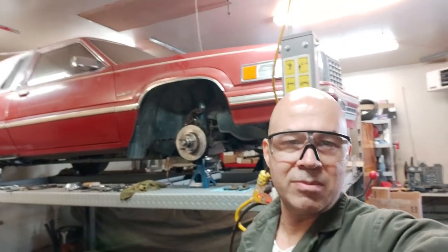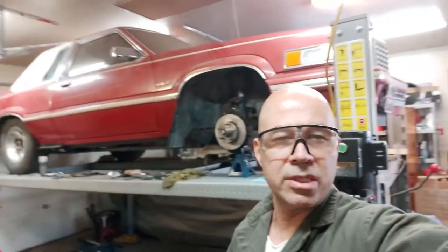That's okay, but the problem is you're limited with the rims you can use. So I decided — well, first I made the mistake — I bought the Mustang 2 kit from Speedway Motors: a nine and a quarter rotor. The spindles are the same, but the geometry of the rotor is slightly different, so it didn't work.